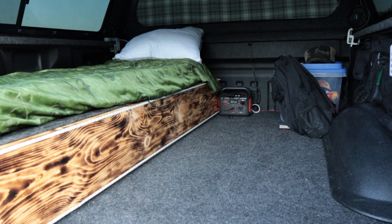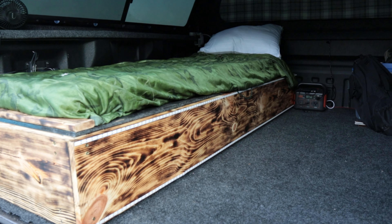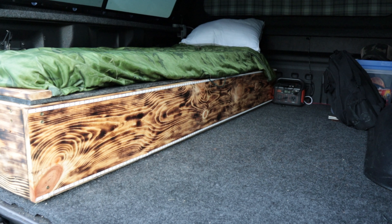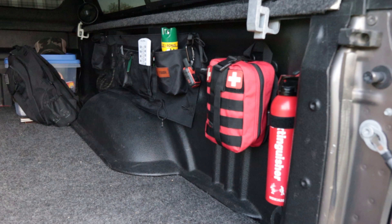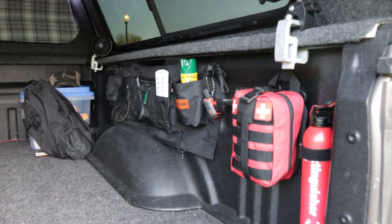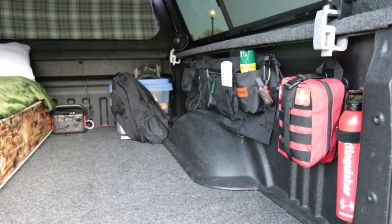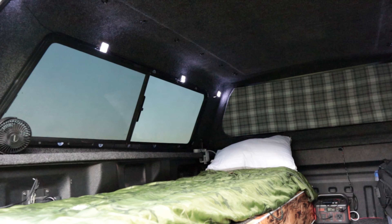For power, up front I'm running a Jackery 240, powering my LEDs and USB fans in each corner. You can see the LED light strips on the bed — all of that is powered by the 240 with no issues, very low power draw. The lights on the bed are red only; I use those at night. You can't really see the red lights, especially with five percent tint on all the windows — really hard to see in here. On this side I have a cot organizer with random things: thermometer, bug spray, an extra dog leash, a first aid kit, and a fire extinguisher. I also carry a Garmin inReach Mini for when I'm out of cell service. The LEDs are just basic LEDs off Amazon — I put Velcro on the back of them and they stick directly to the headliner.